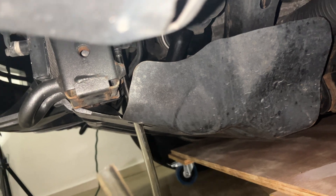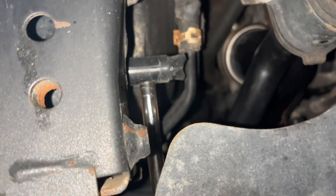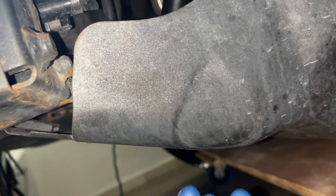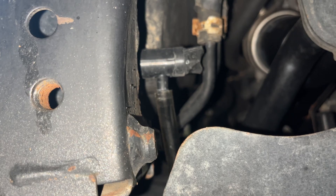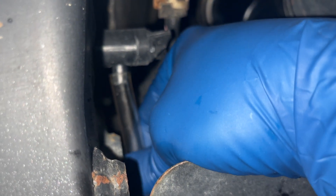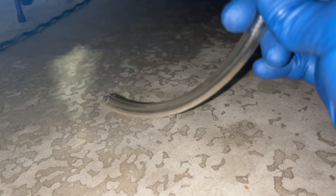Here's the concoction I came up with to drain the coolant. You have the drain cock here, and then your skid plate actually has a little hole down here. Through that I pass a little piece of tubing and install that on there, and it drains down into my bucket here — no mess coolant drain.